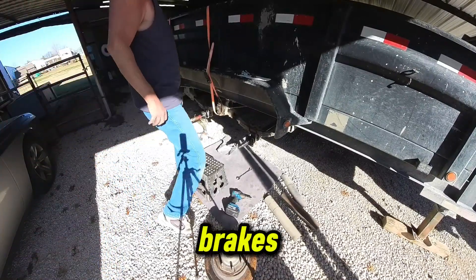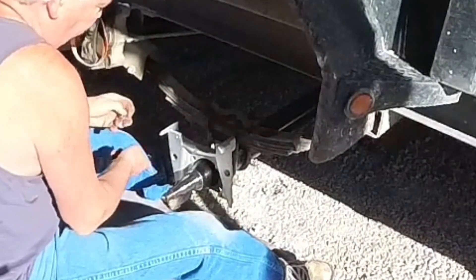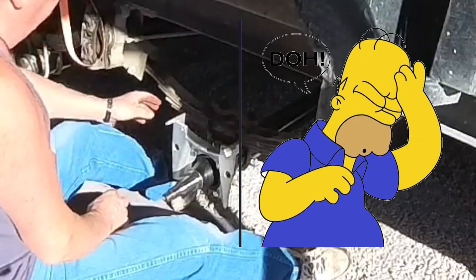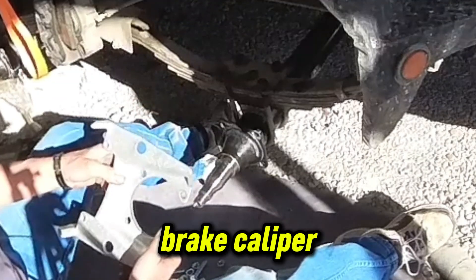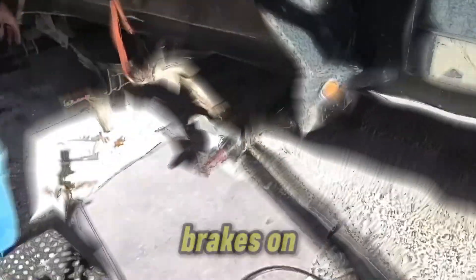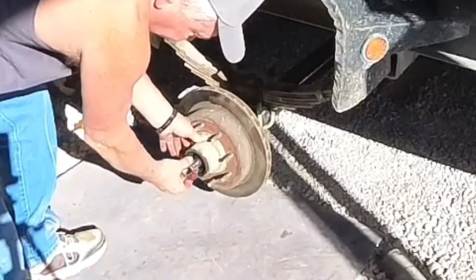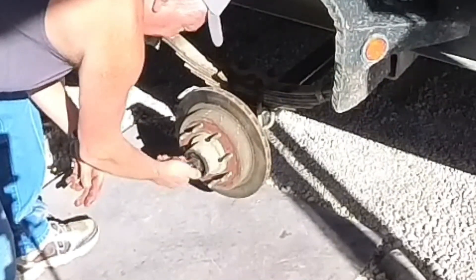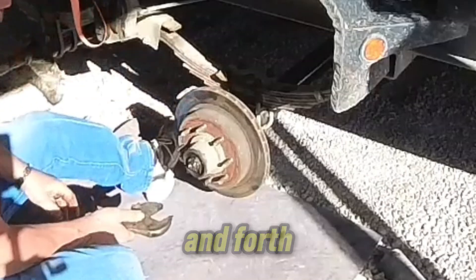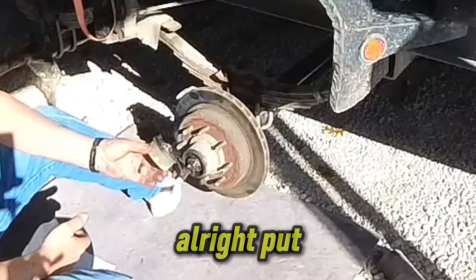Ready to go on with the brakes. Put my brake caliper bracket on, now we can put our brake rotor or drum on. Putting grease on the spindle, then the larger nut and a castle pin — tighten it up but you still want it to spin, no back and forth play. Cotter pin goes all the way through; bend it out so it can't fall out. Ready to put our dust cap back on.